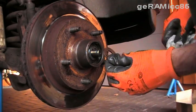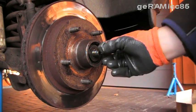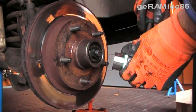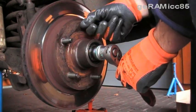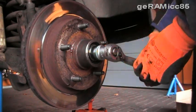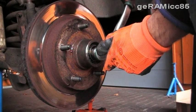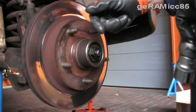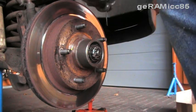I'm cleaning the washer a little bit and putting it back on the right way. Now I'm putting the nut back on. Now I'm taking a 27mm socket and tightening up the nut. Now it's really hard to turn the wheel, and now I'm backing off a quarter turn. Then it's got the right tension. Now I'm putting the safety nut on there and the pin back in.